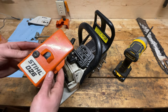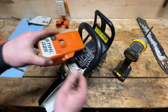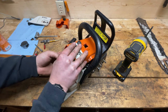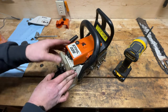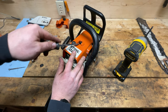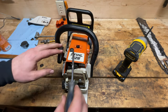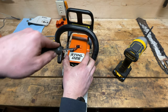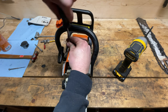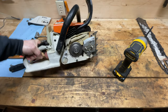Let's try out this top cover or top plastic casing now that we don't need the plug in the way — let's see if it fits. Wow, it's like it was almost meant to be. So this 026 now has an MS-260 piston and cylinder and with that, the decompression valve. Pretty awesome.